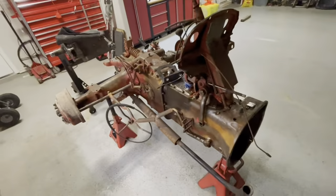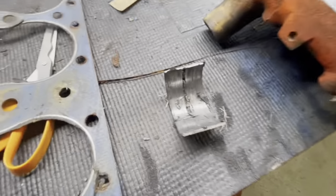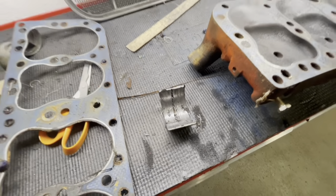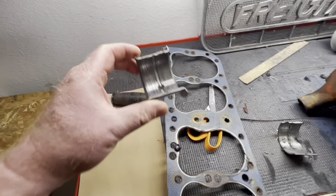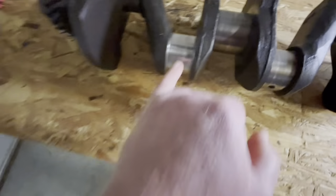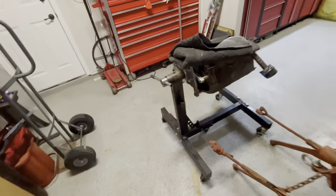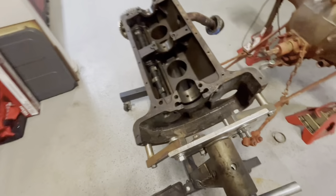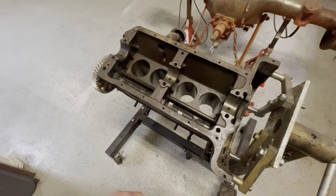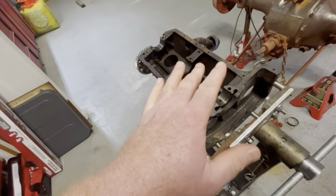As you can see, I've got it pretty torn down at this point. One of the things I ran into is the last main bearing — none of the bearings look too good. They scarred the crank up some, not too bad, but it definitely needs touched up. When I went to take the mains off, I pulled the cam out of this block — the block looks good, and I popped all the liners out and they all look good too. So the block and stuff doesn't look like I have a problem there.